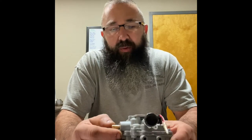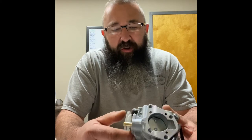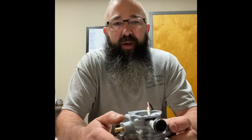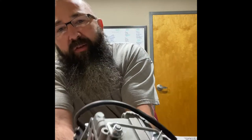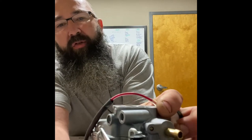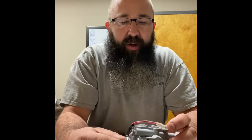When I was building my Opposed Twin looking at carb options, I was going to modify a stock carburetor, and we all know that the stock Opposed Twin carburetors are garbage. He says, why not put a Kohler Command pumper carb on it? I didn't even know they existed. When you hear people talk about a pumper carb, it's an accelerator pump like an automotive carburetor would have. You've got this diaphragm down here, hooked to your throttle linkage. When you work the throttle, it works a little diaphragm and pumps fuel out of a little squirter tube in the center of the carb. It's just better low-end throttle response. You don't get the big holes and bogs in them.